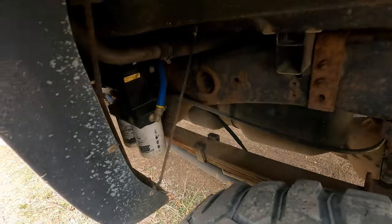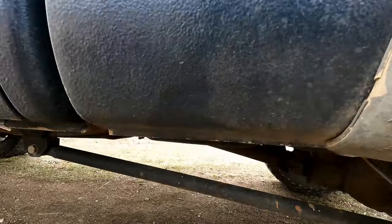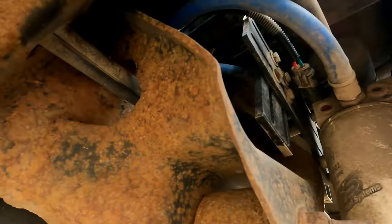Number four applies to pretty much any diesel truck: an aftermarket lift pump. I have a FASS fuel system — it's a much better upgraded lift pump and it supplies a ton of fuel right up to my CP3 injection pump, so it's never hurting for fuel. You want to do this especially with that tuner, because if you're cranking up your tune you're calling for more fuel and sometimes your stock lift pump can't keep up. Another great thing is they're super easy to service — there's a fuel filter and a water separator right there, easy to get at and easy to change.